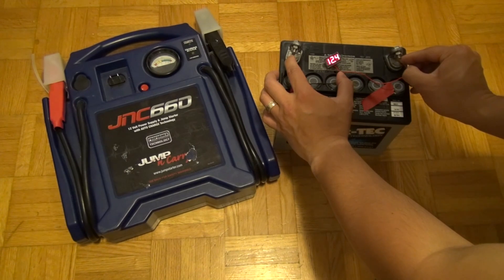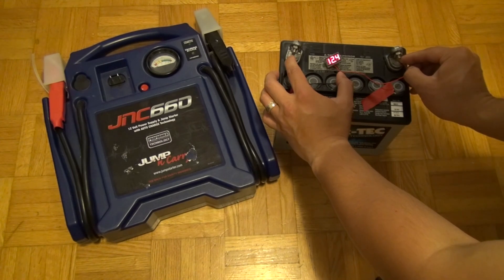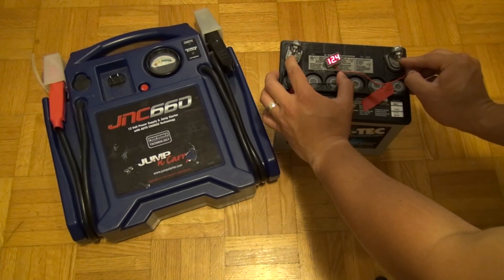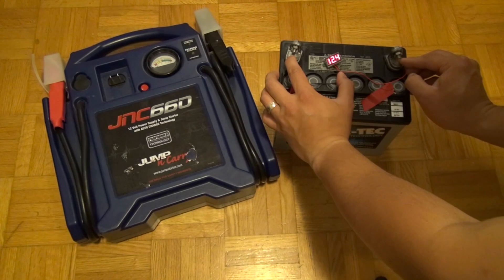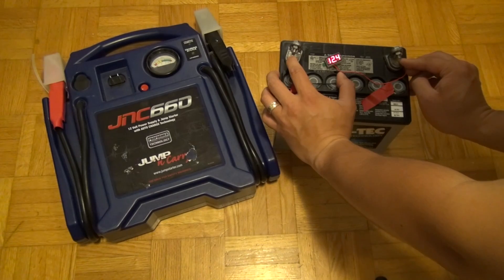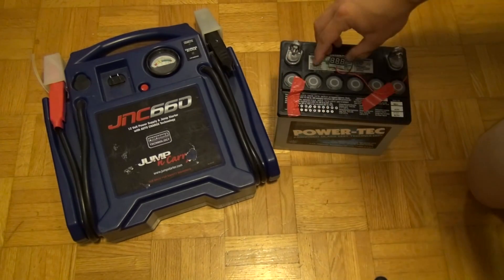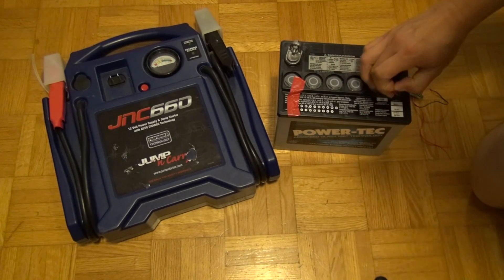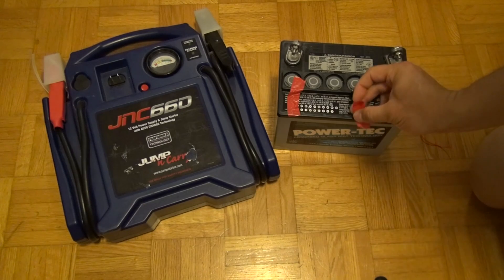That's 4 hours of my type of fly fishing at Paul Lake where I'm using it just to get to spots and very minimal trolling, but it is a pretty big lake. That's also roughly the voltage I had at Tuwonka Lake - that lake is a lot smaller. With a 32 amp hour battery and the Minn Kota motor without the digital maximizer, it's pretty good.